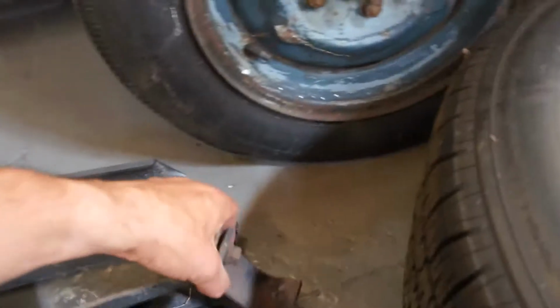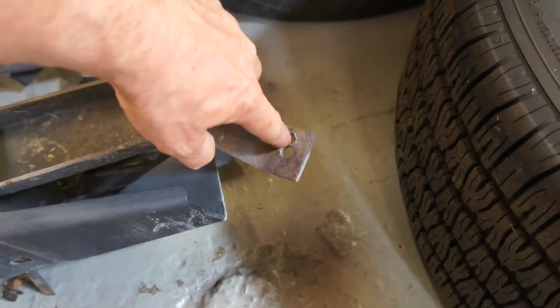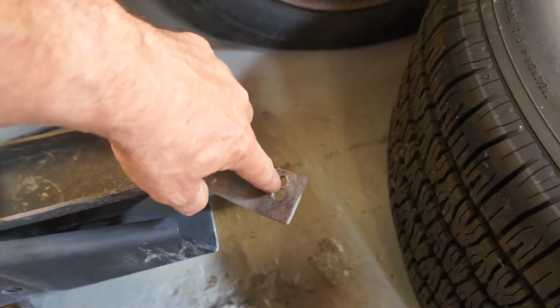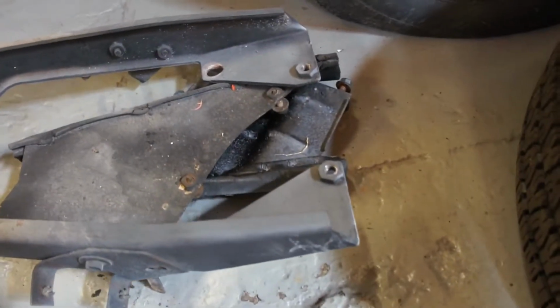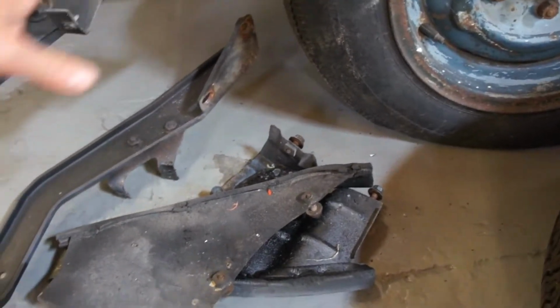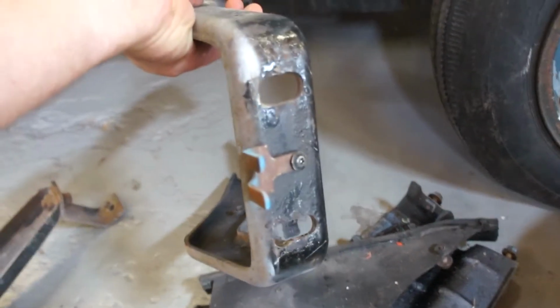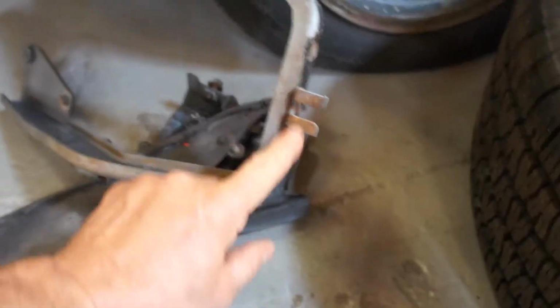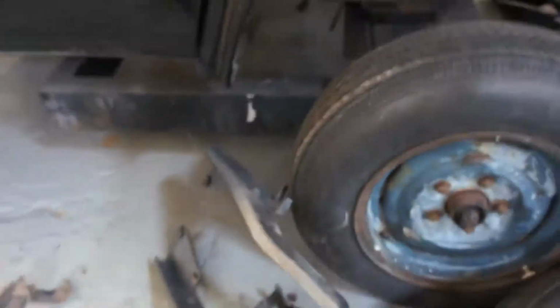We've got some of your front end metalwork down here, and if you take this one as an example, you see it's this hole here is where the front bumper bolt should go through, and they've had to drill another one here to allow the bumper bolt to hit the bumper. So it's that kind of thing that I'm talking about, just a little bit each way. And this front bumper support had a load of shims between it here, and they'd also put a bent old wheel alignment shim in there, which is this thing, to lift the front end up some because the nose support rod was missing. But we'll put all that right as part and parcel of this job.